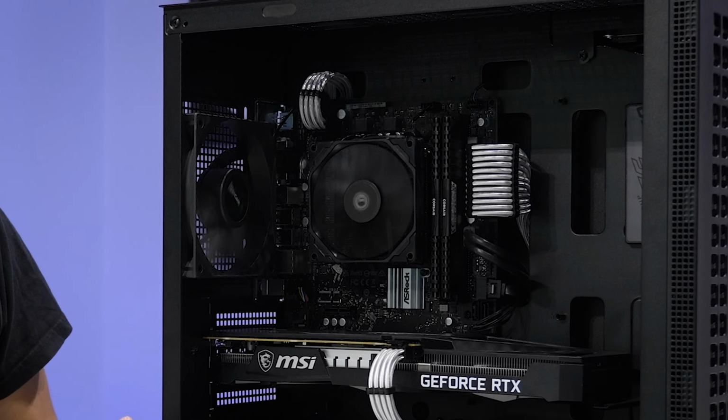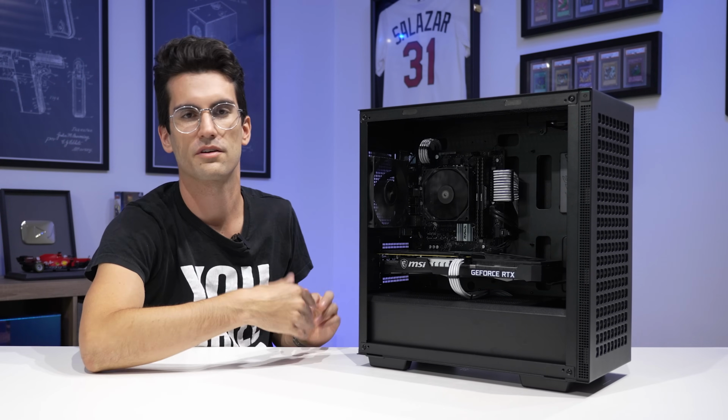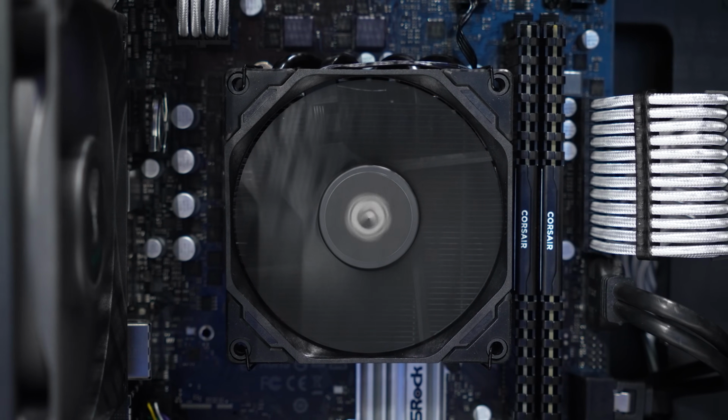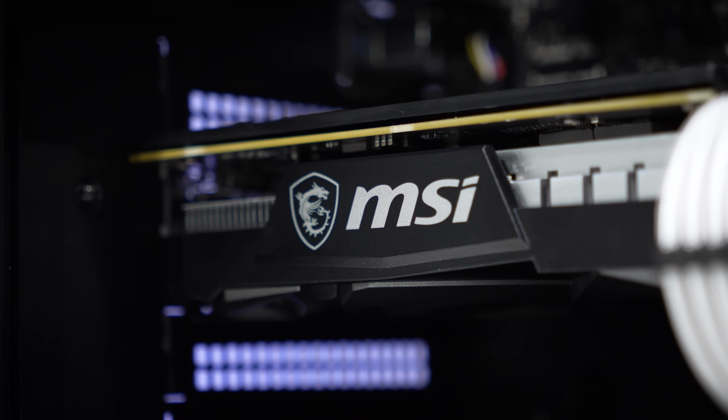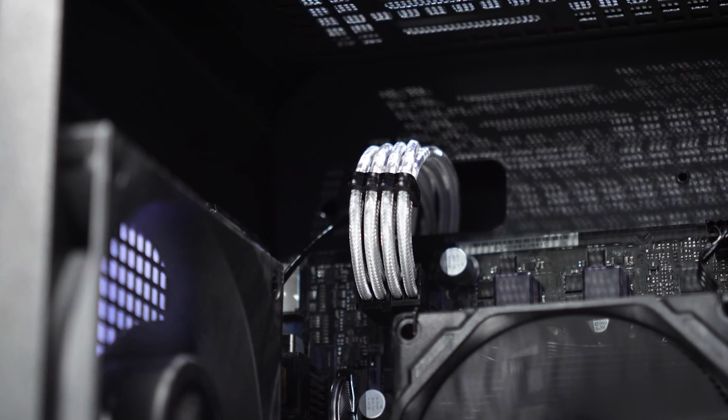Okay, bit of a delay. Fans are spinning all across the board. That's always a good sign. At least cheaper motherboards aren't gonna have debug LEDs or Dr. Debug screens, notifiers. So we're gonna have to connect this to a portable monitor and make sure that everything functions as it should and that we get a proper POST.